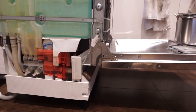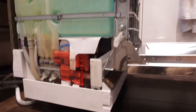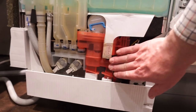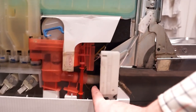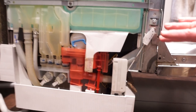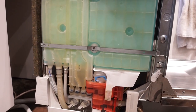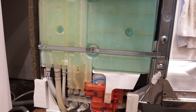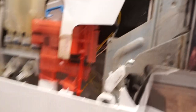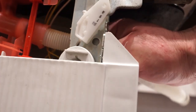You can see what was blocking the machine up there. The repair definitely works on Siemens machines and I think it also is the same for Bosch, Neff, Gaggenau, and a few others that all share this same design — a pressure tank on the side with a tube running out of the bottom into the drain. It's basically the transfer of water from the expansion tank on one side, through the valves at the bottom, and into the heating element on the other side of the machine.